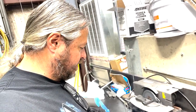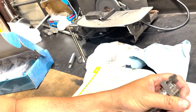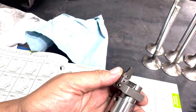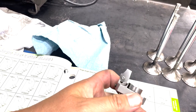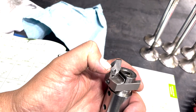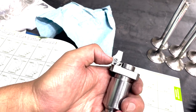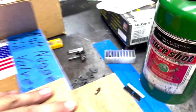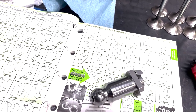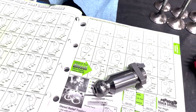We can't talk about valve jobs without talking about the insert and how we accomplish this. Basically, the way this works is we use a cutter like this one that bolts onto a cutter body that is turned in the valve seat and scrapes off metal. The profile we're trying to cut into the seat is in this cutter. Therefore, with most standard valve machines, if you want to change the profile, you have to change the cutter. I have dozens of these things that we use depending on the valve job we're trying to achieve, which is determined by the cylinder head, the chamber, numerous factors, the type of racing, the time between rebuilds, and just tons of stuff.